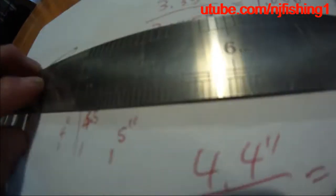So I took these two pieces of fishing line and used my ruler to measure them. The shorter one — the outer bearing — came out to be 3.35 inches. Every little grid is 0.1 inches. You can see that's 3 inches, then 3.1, 3.2, 3.3, and then almost 3.4 — so I say 3.35 inches. So 3.35 divided by 3.14159, which is pi, gives you 1.066 inches. The standard 84 spindle axle spindle is 1 and 1/16 inches, which equates to 1.0625 inches — so using just 20 lb fishing line, I get 1.066 inches, which is very close to 1.0625 inches.